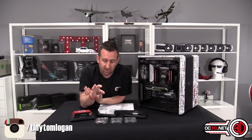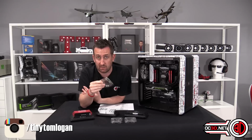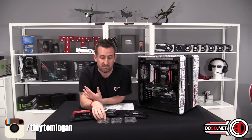And even with the overclock that we'll talk about in a second, we were hitting a maximum below 75 degrees, which sounds like a lot, but you do need to remember you've got 10 thumping cores here. When you hear the volts that I put through it, you'll understand why I was quite impressed with floating between 70 and 75 degrees as a great temperature, considering I've just got it off the shelf, nice and easy, click, bosh, do you know what I mean? It's all the type of stuff that you can get.